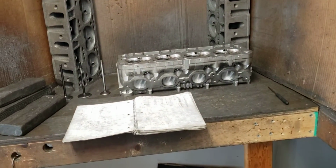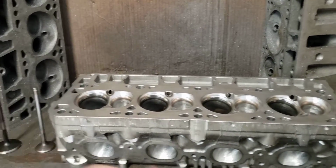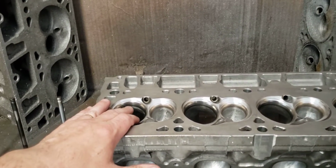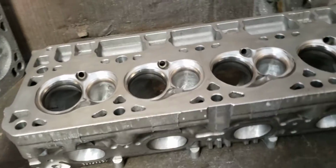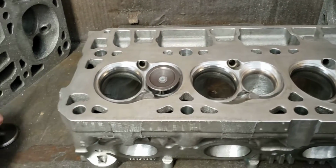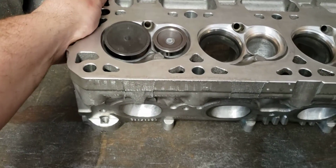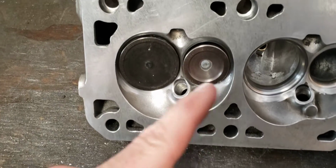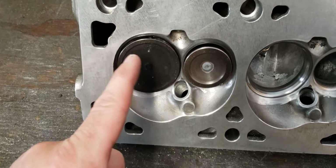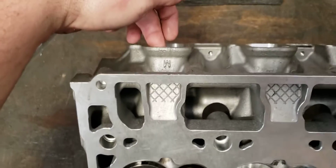So when we talk about where the important airflow is, we're trying to achieve over 100% volumetric efficiency in a naturally aspirated motor. What that means is that we're actually exceeding the port's volume to flow air. And the way we do that is with valve overlap. Valve overlap is the time where both the intake and the exhaust valve are open into your cylinder. So at that point in time, what we're trying to do is have a bunch of exhaust velocity still leaving while the intake port opens. Now we've added vacuum to air coming in from the intake manifold.